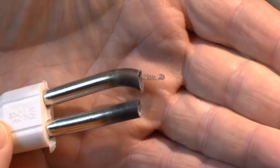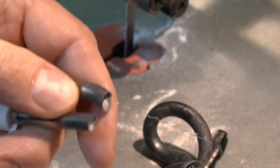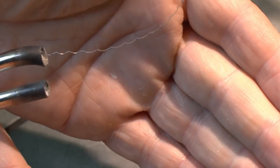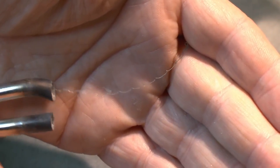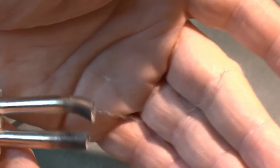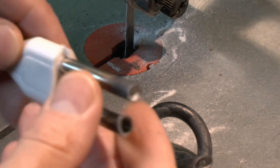So there's the wire — just pulled a bit out of the inside there, and if we get hold of it we can just stretch that out. It's just a very thin resistive wire, so obviously that's what gets hot when the thing is powered on. And of course the heat is conducted through the material to the external casing.